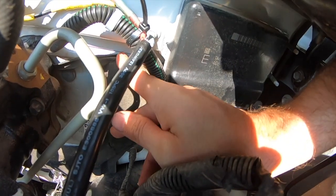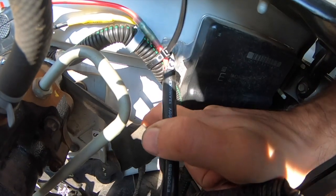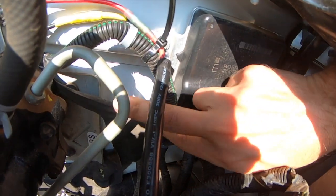Pull that down. What you're going to do is pull the insulation down and there will be an indent in the firewall from the factory. That is what you're going to drill your hole into — this little indented hole that comes from the factory.